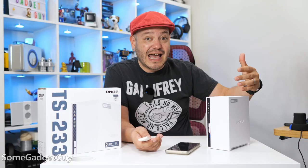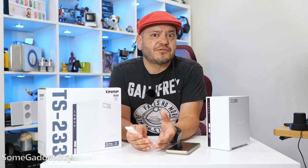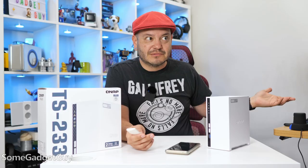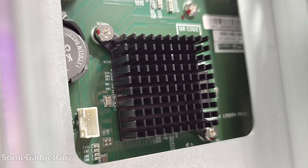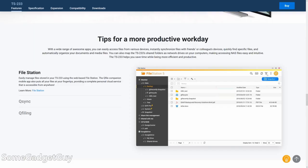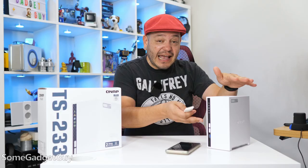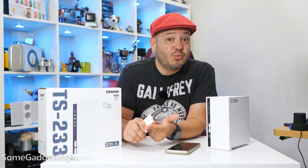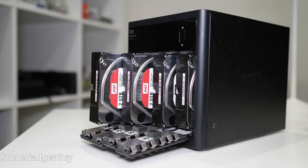This storage is way more useful locally, where I can stream and edit video when I'm on my home network — that's the thing I love about a DIY cloud. When you're out and about, it's not much different than Google Drive or iCloud. In fact, this might even be a little slower if you're on cable broadband, as you're at the mercy of your home network upload speeds. But when you're at home over Wi-Fi or Ethernet, the connection speeds are just as fast because you're directly connected to that box over your router. It's so much more robust than a big USB drive hooked up to a family PC because any phone, any tablet, any computer can access it locally on the network all at the same time. You can set up auto backups just as easily as from the cloud — as soon as my wife is on any Wi-Fi and her phone is charging, it will automatically upload all of her newest photos and videos to our NAS without her having to touch anything.